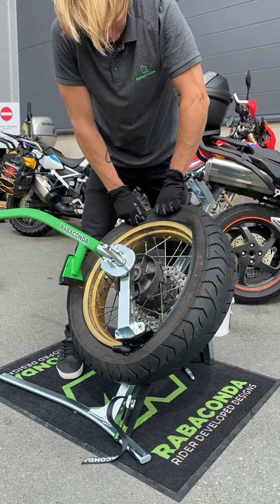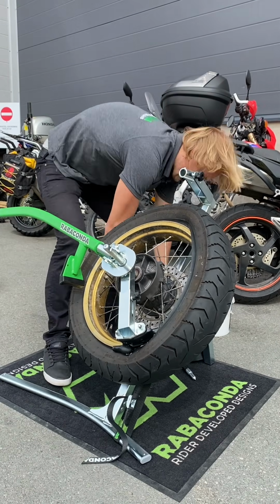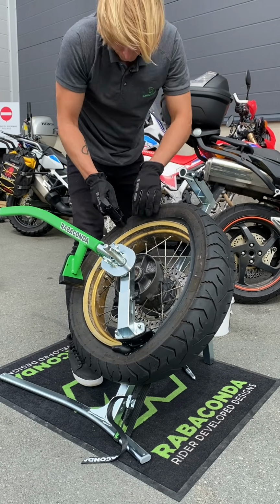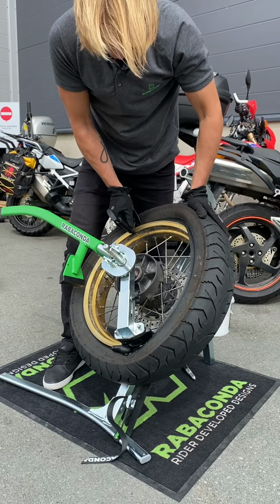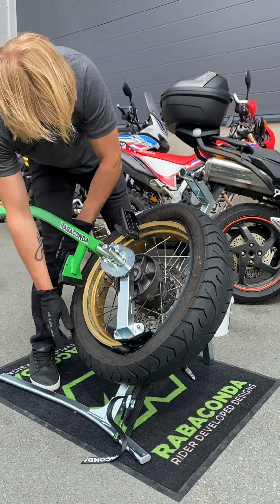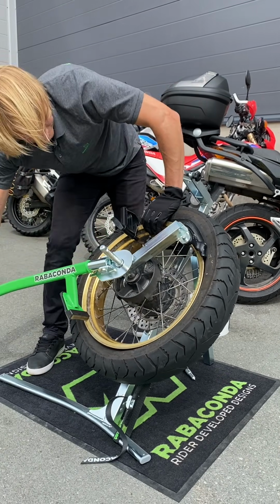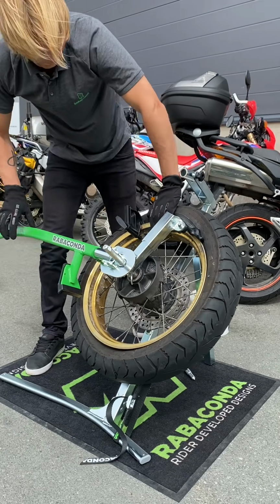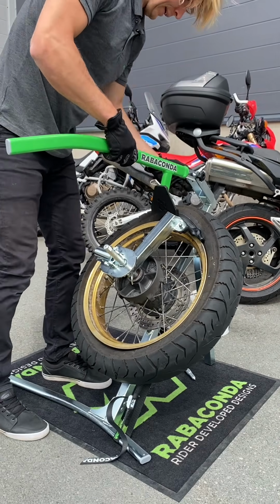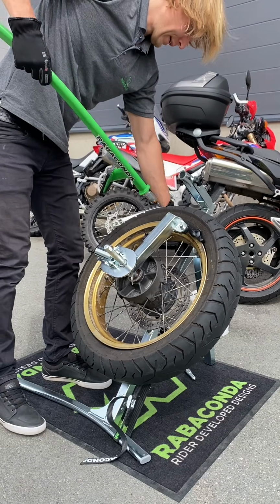Once you get there, make sure the tire sits in the drop center. I might have put a little bit of too much pressure inside the tube, so I will just use a drop center tool here to finish the job. There you go. Pushing the tire over the tail of the duck and mounted.